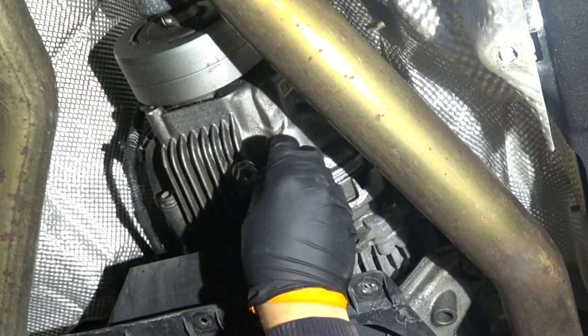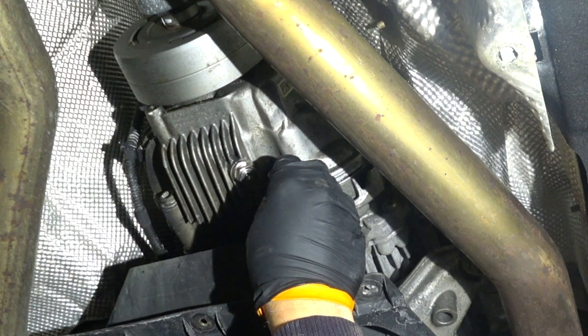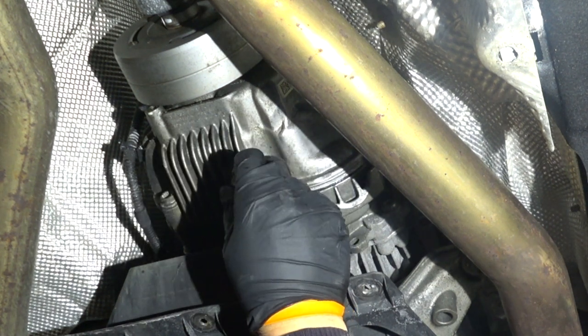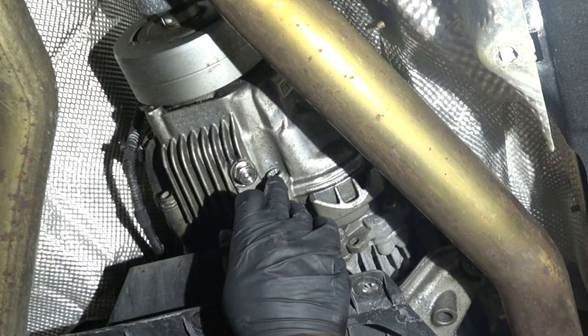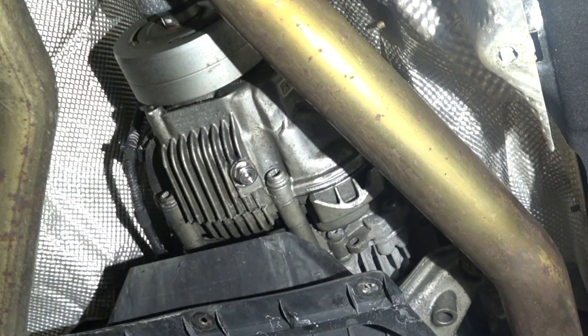But it was too late for me, as I followed the torque specs every time, even when I noticed that every oil change, the plug would go in just a little bit more. My drain hole was in the plastic deformation zone and went to the material fracture point during the last oil change, most likely like it happened with the other Macan forum member.